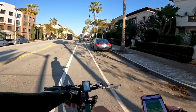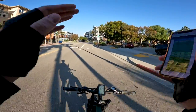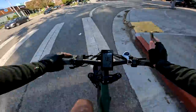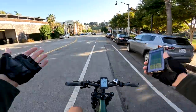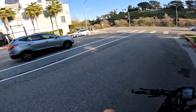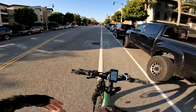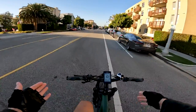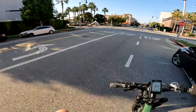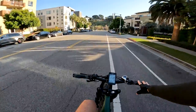Just making it back into the neighborhood here. Battery is showing 47.9 to 48 volts, which according to the chart is about 55% battery. I just crossed over 20 miles on the odometer, which puts this ride at 18 miles. So if we do the math out, that'd be about 37 to 38 miles I could expect riding this bike weighing 195 pounds. So if you weigh less than that and you're riding less aggressively than me, you'll get more range — so actually not bad at all. 18 amp hours on a 48 volt system performed a little better than I was expecting, honestly. Especially considering all of the performance tests I was doing — acceleration test, hill climb test. The bike actually performs pretty well. 18 amp hour, 48 volt battery is on the larger side for these fat tire e-bikes — 20 amp hours is about the biggest battery we ever see in a fat tire e-bike, so 18 is pretty legit.